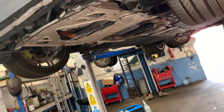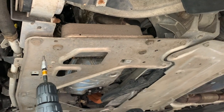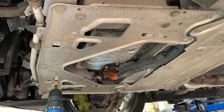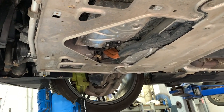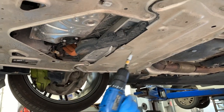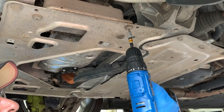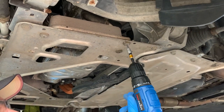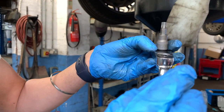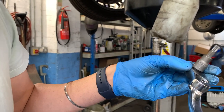This is how it differs if you have a 970 model: your oil filter is actually located underneath this brace. You'll use a 13 millimeter socket and remove the six bolts to take it off. On the 971, on most engine models unless you have a turbo, it's up top — so since I have a 971, mine is at the top and I'm not taking this off.